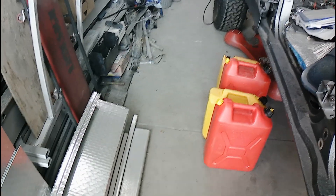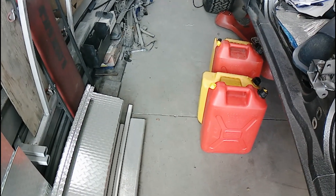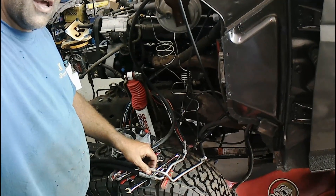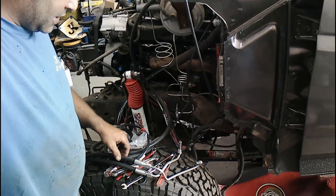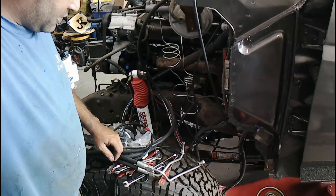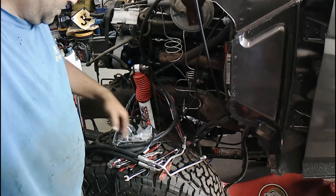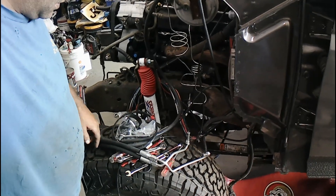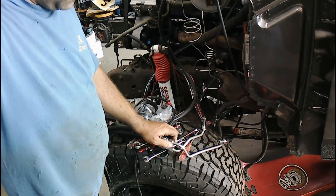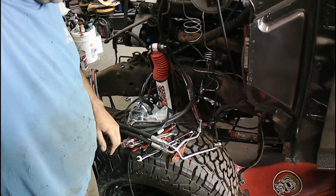Unfortunately, a day late and a dollar short as our carbon tax seemed to rise again today. The other thing I had done here is power steering lines — I had to get them lengthened four and a half inches. So they're now custom and replaceable, with a hydraulic hose in between. You can line them up, you can do whatever. So we'll be getting into that here.